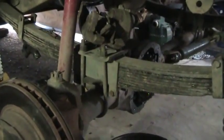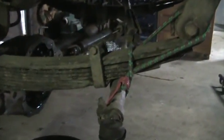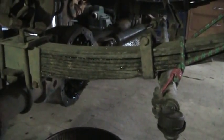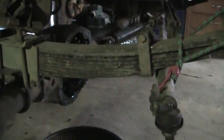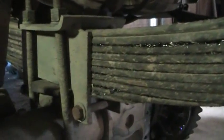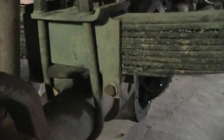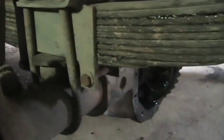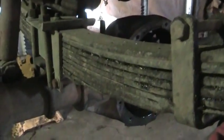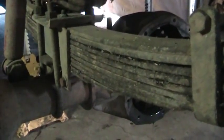On my perches, I was having problems because I didn't have enough clips on the springs, and these leaf springs were twisting out and coming dangerously close to my tires. So I went back on the perches and installed a side plate between my bolts — I had just enough for a 3/16th piece of plate on each side. They're flared at the bottom a little, angled out from top to bottom, so you can slide it over easily.